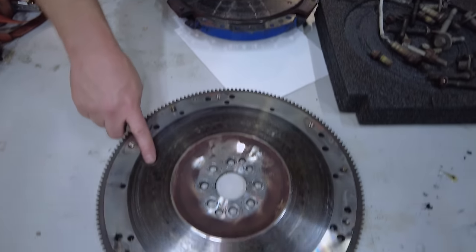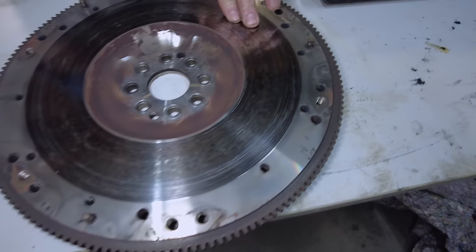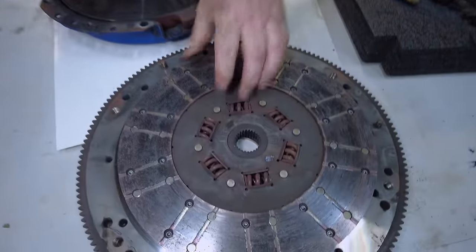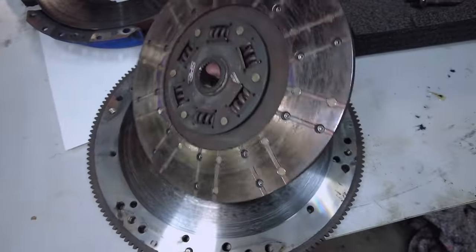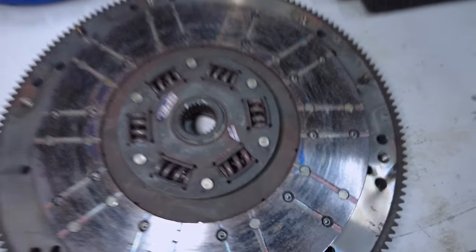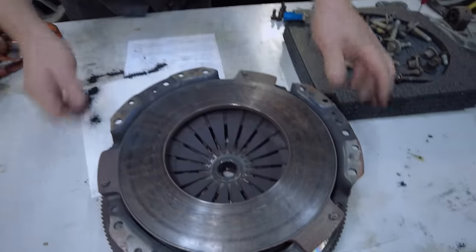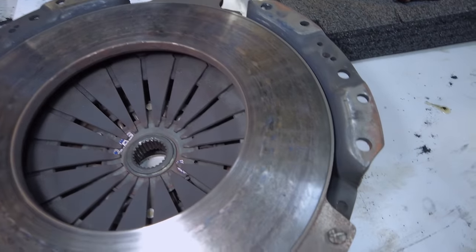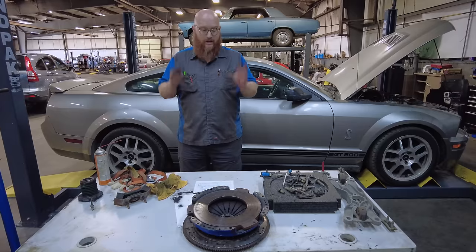You can see the flywheel has a lot of hot spots — it got really hot. I don't know if it can't handle the power since it's got around 570 at the wheels. Here's the clutch disc. It looks like a semi-metallic or some kind of weird shiny material, but you can see it got really hot — it's purple and pink. On the other side it's blue; it got super hot. It's a spec clutch. Here's the pressure plate — lots of scoring and really hot spots. This is a single disc clutch, and I don't think it was rated for the power of this car. It was too stiff, engaging weird, and getting really hot. I didn't want that in there anymore.